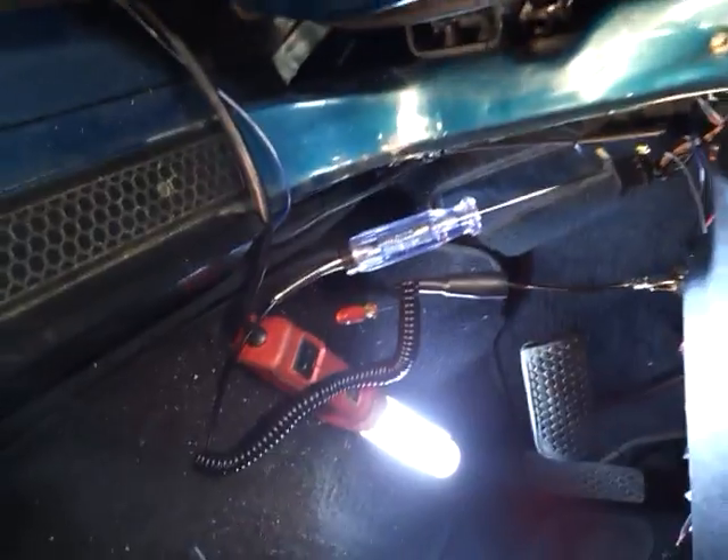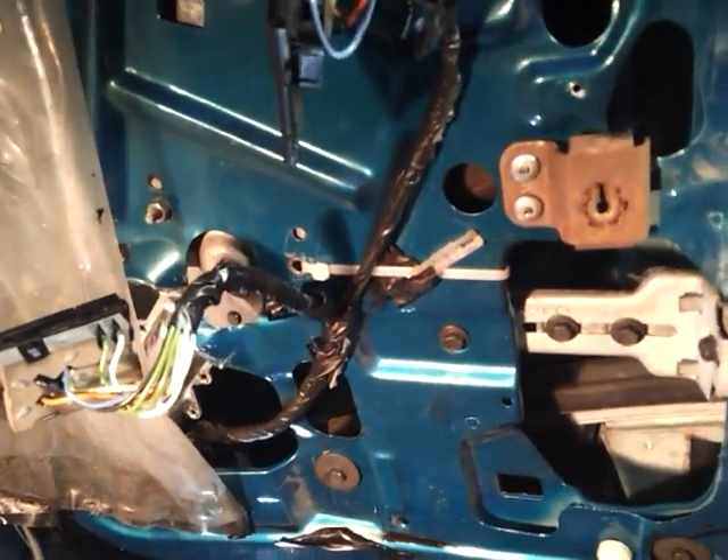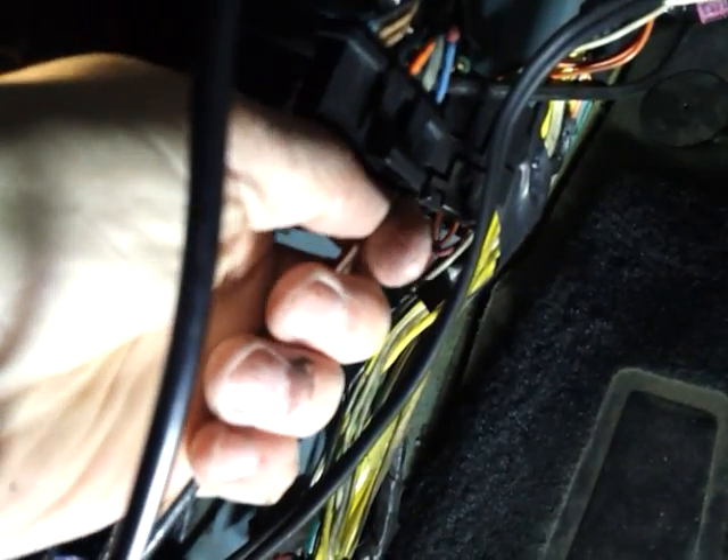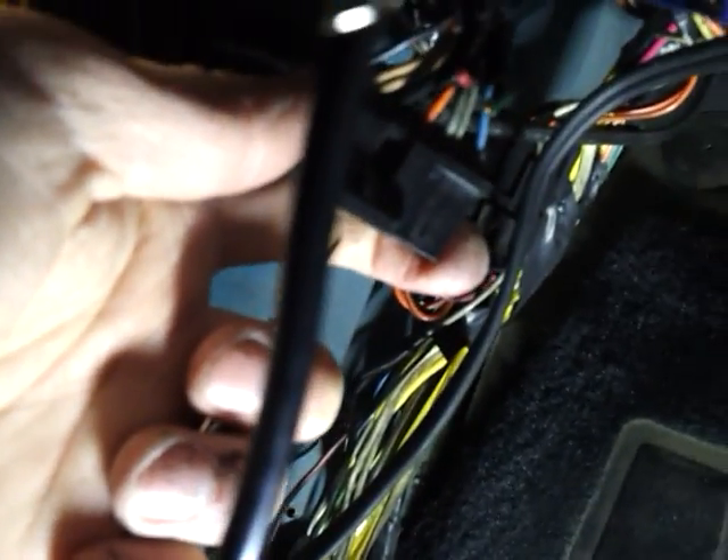Your switch is good for the blue wire. Do the same thing for your black wire. Orange is hot all the time, which I tested in part one's video. Do the same thing for your black — do your wires to see if you get power to your black. Let me just connect this to the orange wire — your orange wire should be live at all times. Your orange wire here is your third pin from the right, and that's coming from your circuit breaker — 30 amp circuit breaker. So you can go ahead and continue and test all those.